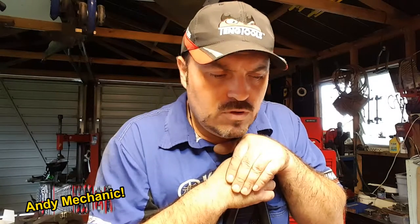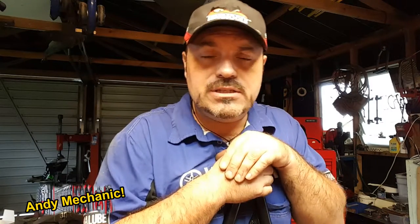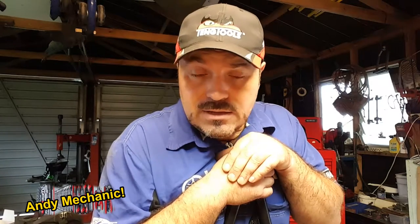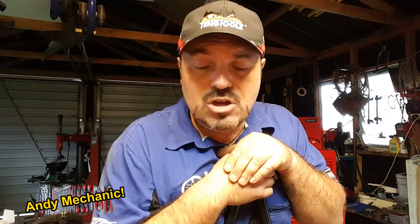It was still tight in all directions in its full movement. There were no slack points, and there were no really tight points. It was even tightness throughout its full movement. And there was no knock, there was no play when pulling that joint in and out. So the inner joint on the steering rack on the left-hand side is fine. And on the steering rack itself, there's no indication of any kind of play or damage to the teeth. It's smooth when you move it lock to lock as well. So we're quite happy with that, and we'll leave it well alone.